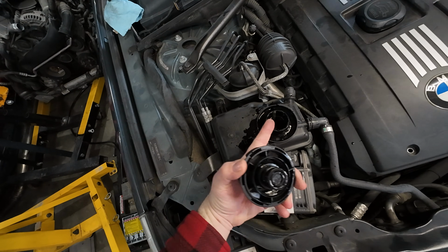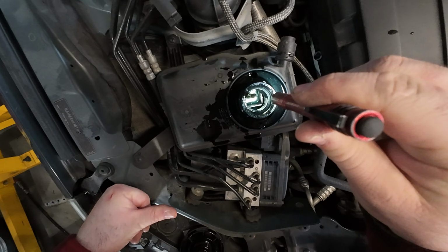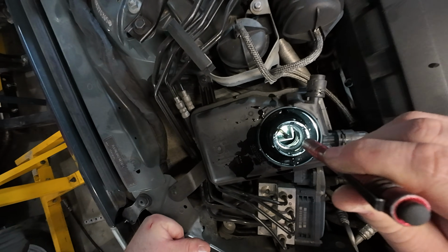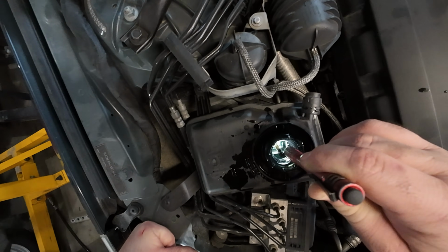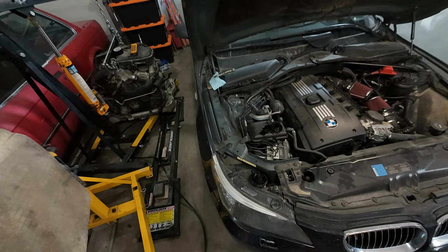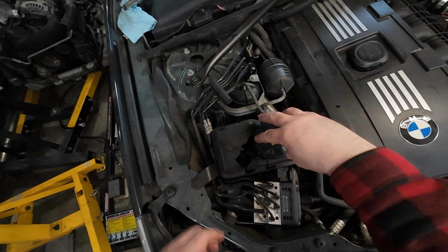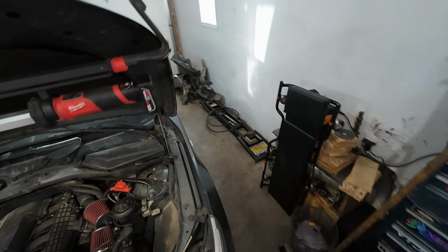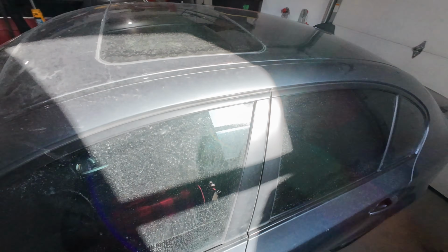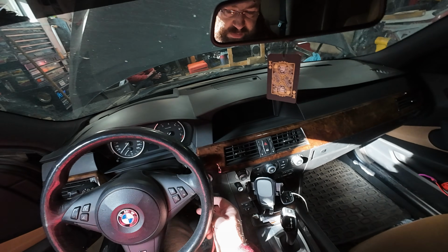Yeah, see, even the stick is meant to be, I think, an orangey red, and for some reason it has green. I don't know if it's going to show you, so I'm going to maneuver my head in certain ways. You can see that the coolant is blue, but there are sparkles and flakes in there, which leads me to believe that a stop leak was used at some point. I do think he said the previous owner just let it overheat continuously, and BMWs are not the cheapest things or the most reliable, but you can't continuously just let it overheat and think that it's going to fix itself.